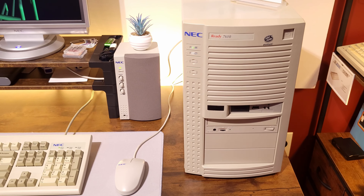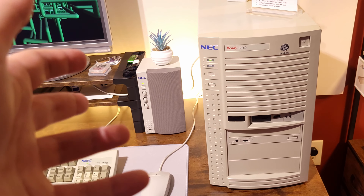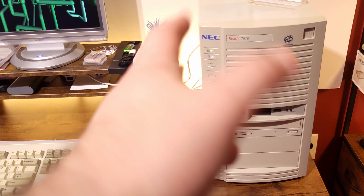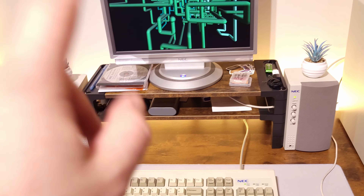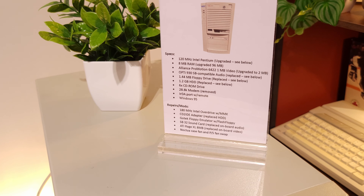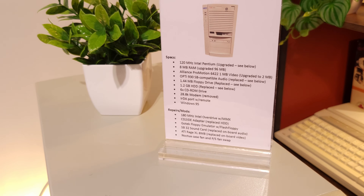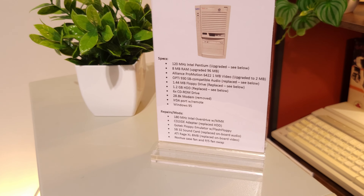This is my NEC Ready 7610 — basically our family's first computer. I was able to find it on eBay and was really lucky because NEC wasn't a huge popular brand, so the odds of finding a 7610 were very low. I paid more than I needed to, but whatever. I also found the speakers new-old-stock, still in box. Still looking for the CRT — one of these days I'll find it. The ATI Rage is out of commission right now; if I try to install drivers under Windows 98 it just locks up the system. I removed the drivers to reinstall them and it won't cooperate, so right now I've got the Voodoo Rush in there for the time being just to be able to use it.